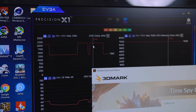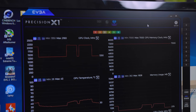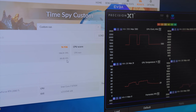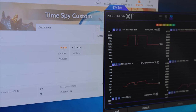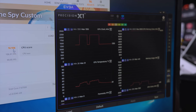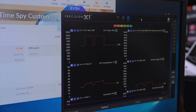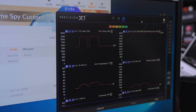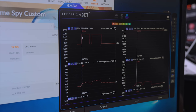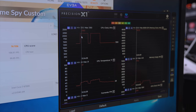The constant 2145 MHz is what's making me happy, and I haven't even touched the memory yet. I'm going to max this out, find where we crash, and tell you where that was. Our max speed here started at 2190 MHz. Because it goes in 15 MHz increments, the next step up was 2205, which was not stable — it would run for a little while and then crash.